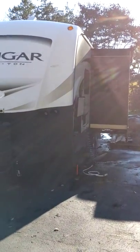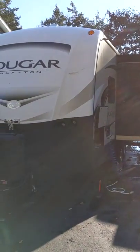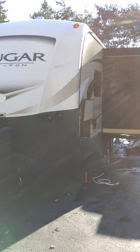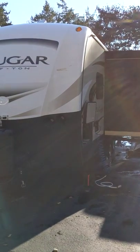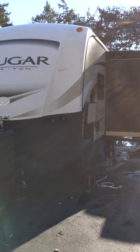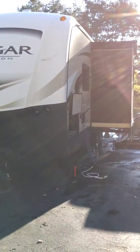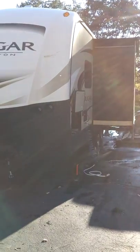A little later, another day when I get some antifreeze, I'll pour some down the traps and I'll actually flush a few gallons, pump it through with the water pump just to make double sure. You don't have to do that — some people do, some people don't. What I've done to prepare is I've drained my tanks, my black water and gray water tank.